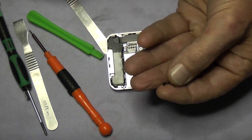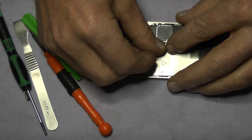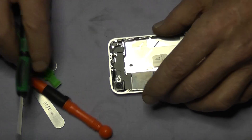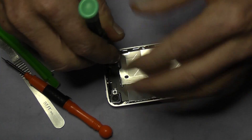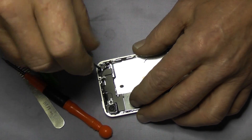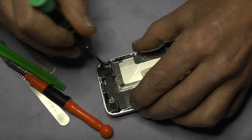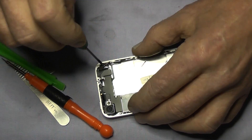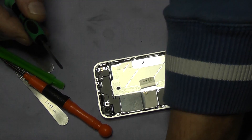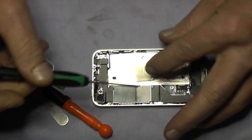This is the cover for the antenna which is held down by the battery screw, so we will fold back this little tab here. The first thing we are going to do is remove the vibration motor — two screws here. It is always a good idea to lay out your screws. Get a piece of paper, do a rough sketch of the phone, and mark off small and large screw heads and place those screws on that piece of paper. That way you won't make the mistake of putting long screws in short holes, because they do have different threads and you can actually end up damaging threads.